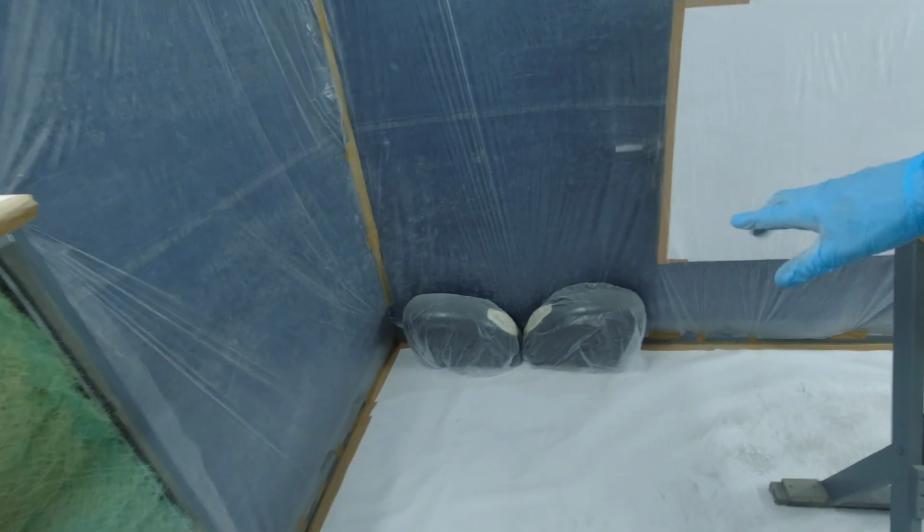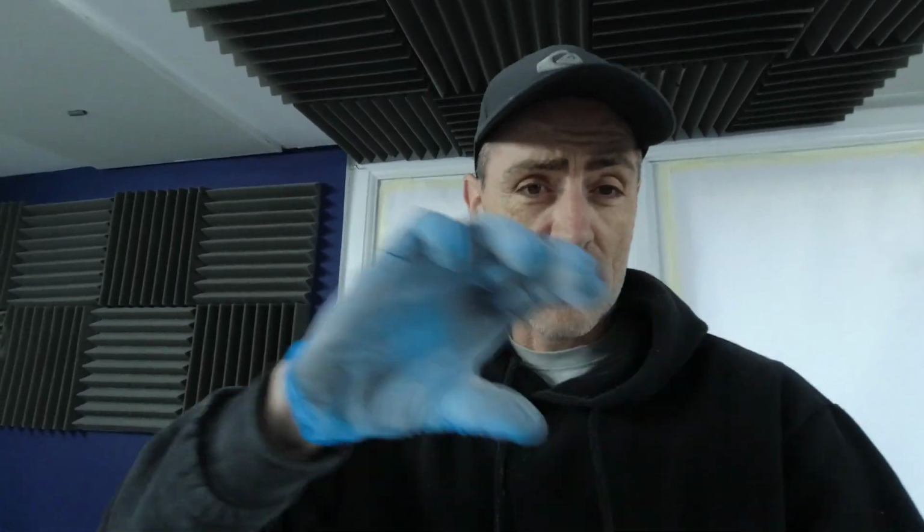So we can clean the studio up now, move that Batwing out the way, and then we're going to concentrate on these. We've got to try and hang these up somehow, because I've got to get them in plastic primer. We've got the side silver scallops that fit on the side of them to prep up, so we're just going to 320 over them, scratch the surface up, and they can be plastic primed as well. Then we can get everything hung up, and I can take you through the base coat mixing and base coat application. I'll see you in the next step.